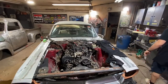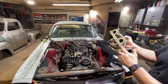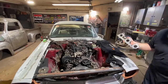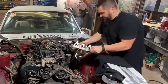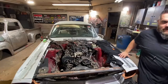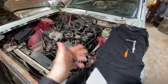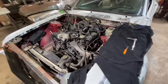These headers have a solid plate across them like most aftermarket headers, but the stock ones don't. On these motors there is all kinds of stuff in the way, and you can take that out technically, but I didn't want to, so I spent the last hour and a half just getting stuff out of the way and unbolted. Now the flange is actually tight to the block — got the other side working too. None of that matters because I need to flip all that around, but I didn't want to start cutting and modifying if I couldn't at least get the flange sealed to the block. We're good.